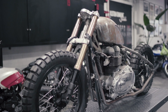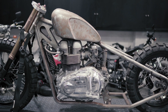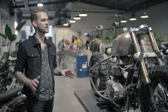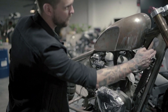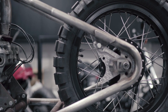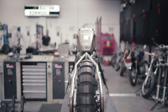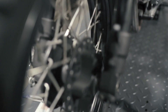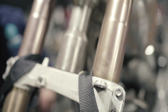We changed the rake, the stretch, and put a Gixxer front end on it — this is where we're at. It's going to be a pretty special build; we're going absolutely all out. The frame is built out of three pieces — the front section is one piece, CNC bent, which means we can get tight radiuses without squashing the tube. The geometry is very similar to the standard T100 Bonneville — slightly stretched and lower, but the riding position will feel very much like a standard bike. We put a Gixxer front end on it for no other reason than because we could.